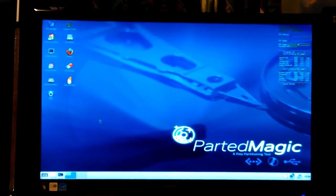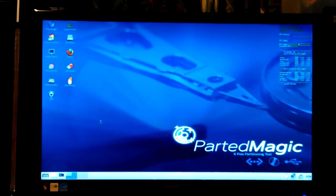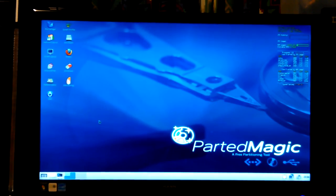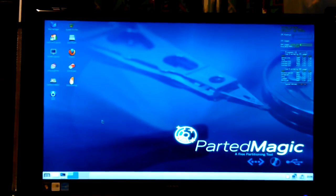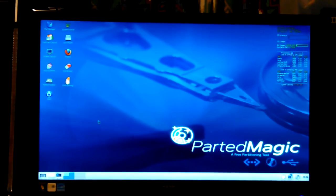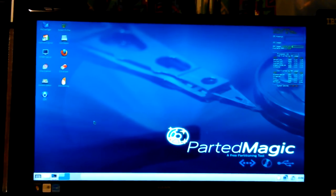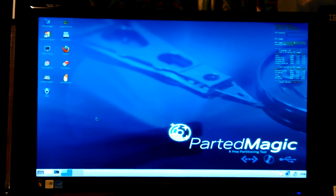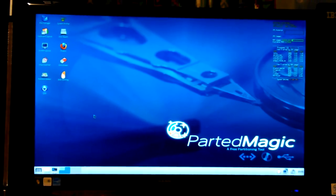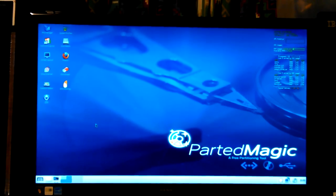Okay, this is Don. Now, that'll be my new plan. What will I do? I will put TeamViewer on one of my USB sticks, and I can plug that into the back of the ASRock. And I can boot to my Parted Magic just like I am right now. I can run Clonezilla from here, and I can plug in my big Seagate backup drive to put the backup images on. That's not too complicated, is it? No, I don't think so. Maybe I'll have to look back at this video and remember what I said I was going to do.